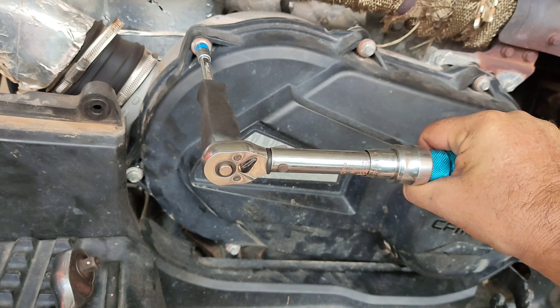It's a pretty straightforward job - the only things that can really go wrong are making a mess when you drain the oil and cross-threading the drain plug bolt when you put it back in. To get this panel off, you pull it towards you - you've got those rubber grommets - then slide it to the rear. Load those as well with silicone spray. The oil filter lives behind here - you've got three 8mm bolts to remove, take off the cap, and the oil filter's inside.